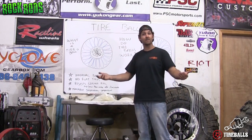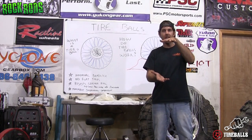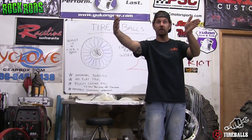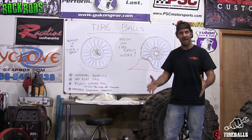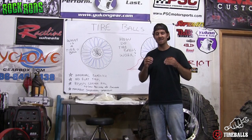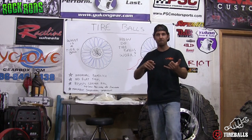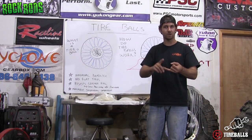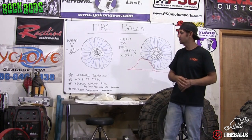Another reason guys run higher pressures is that when you enter a corner with a large tire and it goes in flat, it likes to roll over, and when it rolls over you start pushing into the corner — especially with a spooled front end. With a tire ball you get a flat tire contact patch, and when you go into a corner the tire doesn't roll nearly as bad. So you can run a big contact patch at low pressures and get the benefit of not rolling the tire, not bending the wheels, or cutting the tires whenever you hit an obstacle.